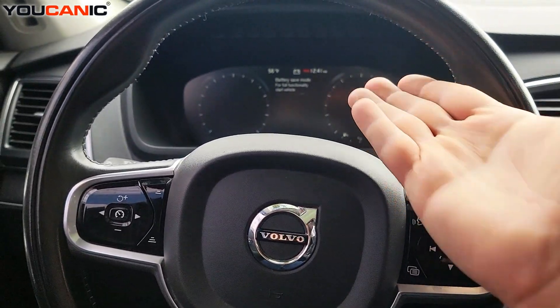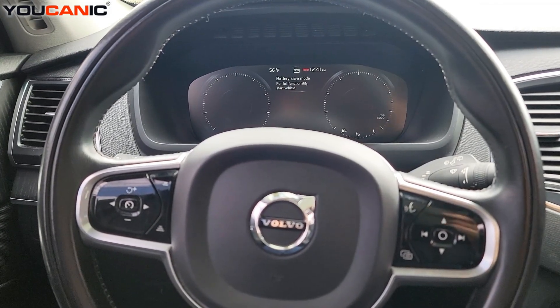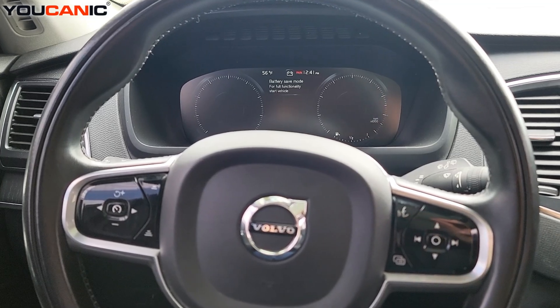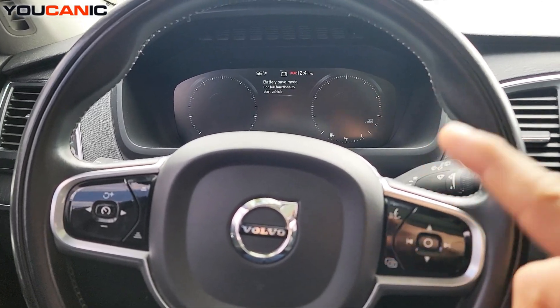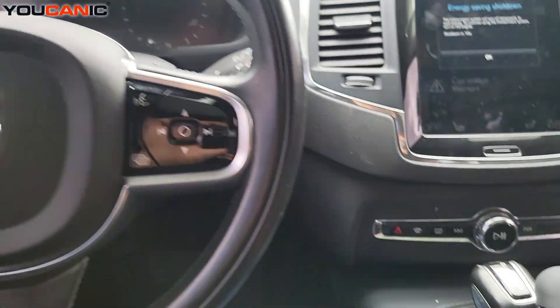You might get errors like that when you turn on the car. Another problem is you might have a bad alternator — a lot of times it's that voltage regulator on the back of the alternator that might cause the battery light to come on even while you're driving. So what you want to do, I'm going to show you something that you could use.